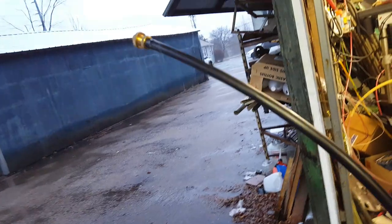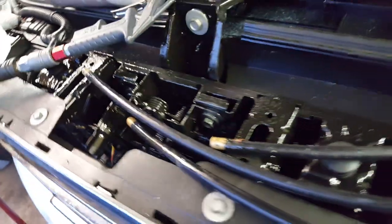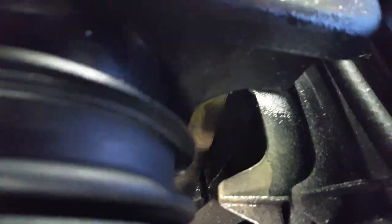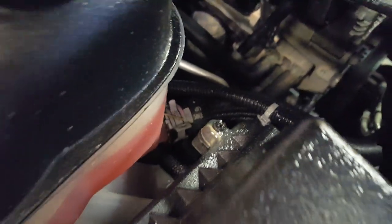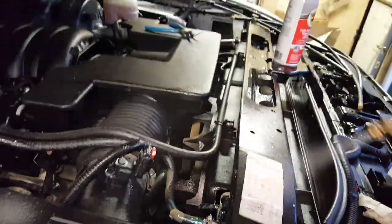There's also one that's about 16-18 inches that sprays forward and out the sides as a light misting. When I used fluid film, there was an extra-long hose, but Bob from Kelsport Products says the wool wax being thicker won't spray through the longer hose — that's the difference in length. I sprayed into the radiator, the hose clamps, the transmission cooler lines, and under the air cleaner. I also took out the air cleaner box bolts and sprayed some wool wax on those, because if it's metal, you want to cover it.